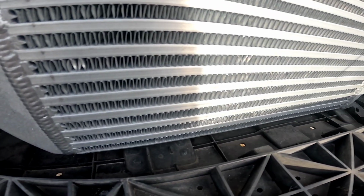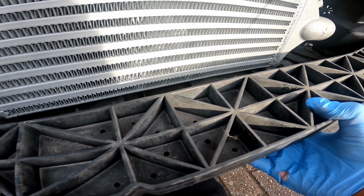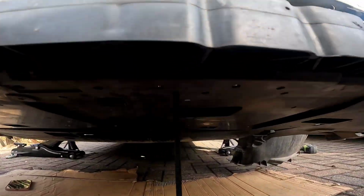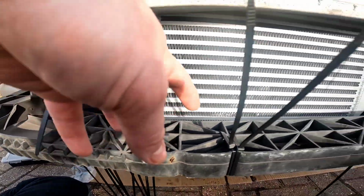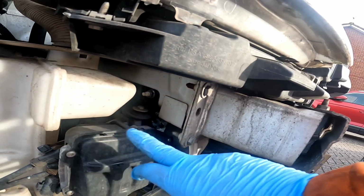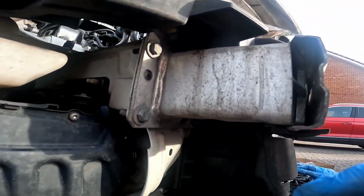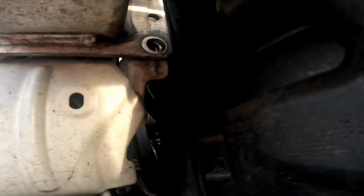This is then going to be clamped down like so, and this will form our base. And we're drilling holes all the way through, cable tie through each, round underneath to hold this. You would get all of your cable ties situated, so you're ready to wrap them around the whole length when done. So we are fitting four washers per nut on the crash bar. You want to get all four off. One is hidden up underneath here. These are 13mm, and the other one is up inside there.